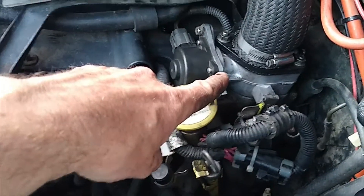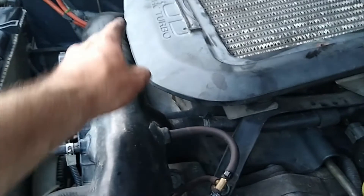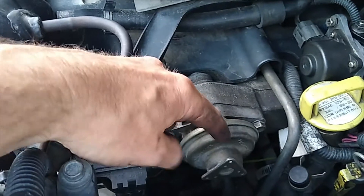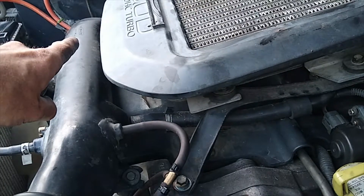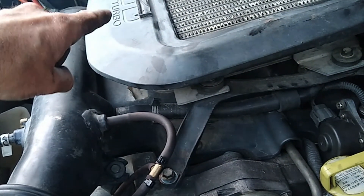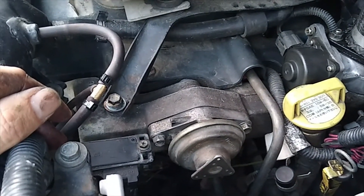Okay, that concludes the video. What we've done is figured out how to remove the butterfly plate out of the throttle body. There is one final third thing you can do: add an EGR blanking plate — not here but over on the exhaust manifold on the other side, because that's where the exhaust gases originate from and come through the front of the head. I'm relying on the EGR valve spring force to remain shut and stop exhaust gases getting in. I'll probably get around to blanking that off one day just to be super safe, as exhaust back pressure could potentially try and sneak its way through by lifting the valve. Hope that helps, thanks for watching.